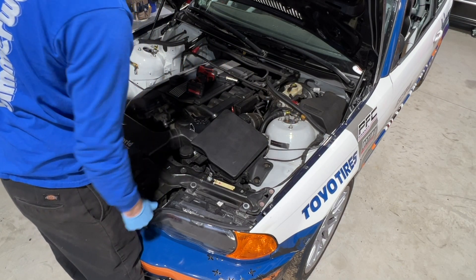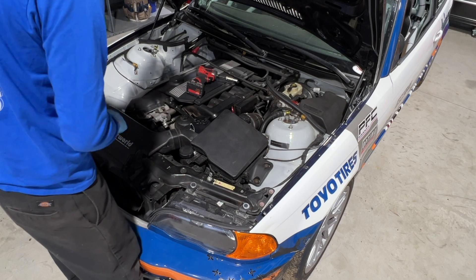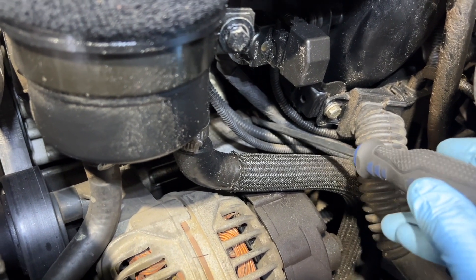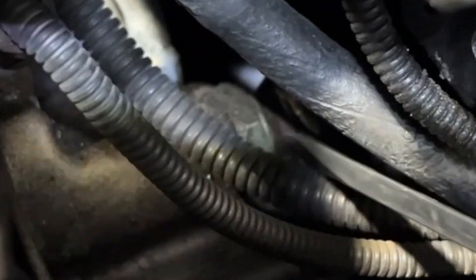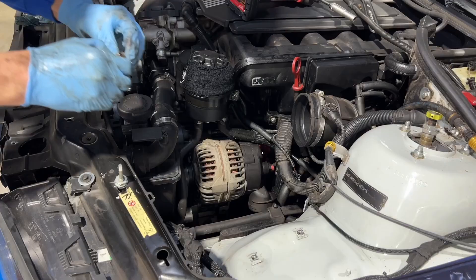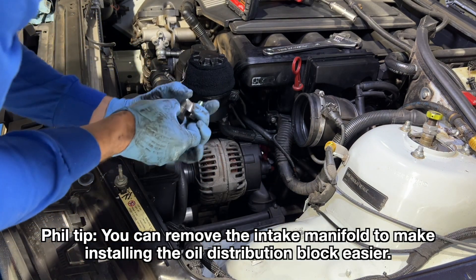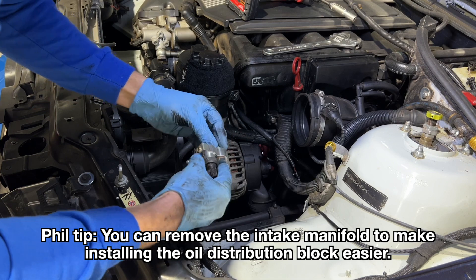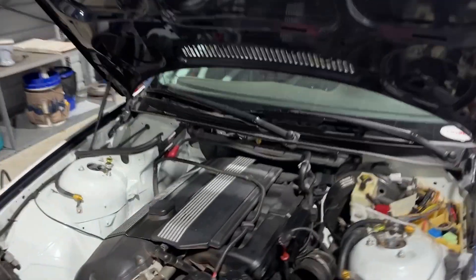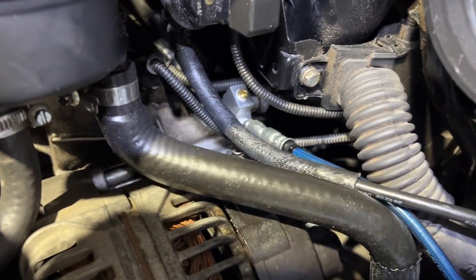Got to gain access under the intake manifold for the oil pressure work. The fuel line and brake pressure sensor tap are back there and over here respectively. Had to weasel around some stuff to get to the oil pressure switch, undid it, and put the distribution block in place. Oil pressure switch is out, distribution block is in, and the oil pressure sensor is mounted. Got the pressure sensor mounted with the remote line routed over the distribution block and up under there.